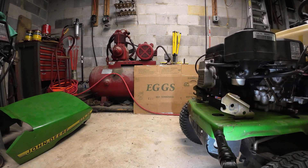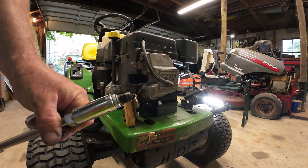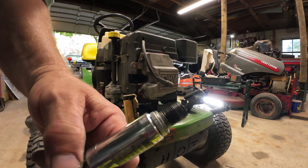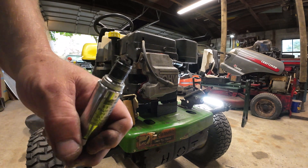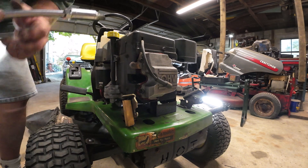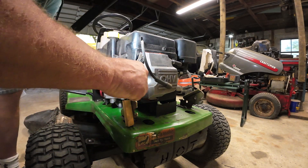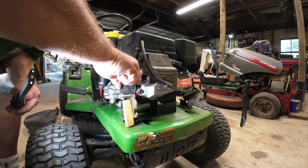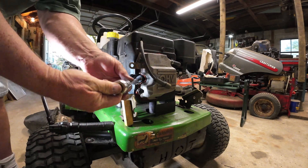It seems like it's got a little miss. This thing keeps rolling around on me. Let me take out the spark plug and see what that looks like. Yeah, she's got some carbon in her too. Got a little bit of carbon buildup — I'll go clean that up. Actually, I've got a different spark plug, hopefully it'll work better. It's always good to start them by hand. She's all the way in. I'll just give her a little snug with a wrench. All right, that's it.